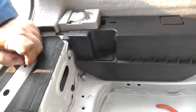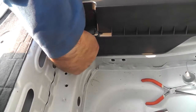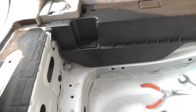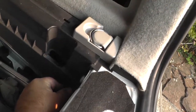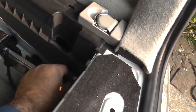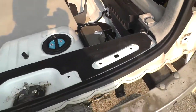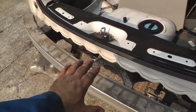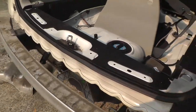and it's visible and accessible inside there. Right now, I'm going to put a nut on just a couple of turns on each of the upper bolts, one per side, because I'm going to go underneath and remove the four that are now accessible with the removal of the heat shields, because I don't want any risk that this heavy assembly is going to fall on me. So those nuts will retain it.